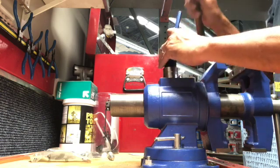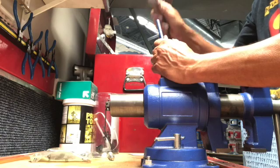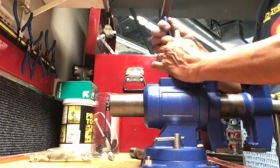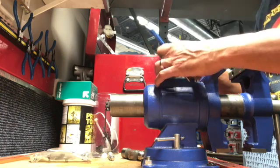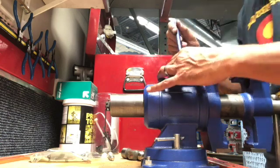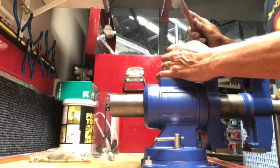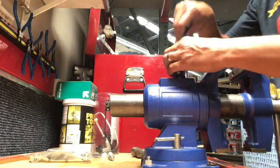The socket gives you something nice and solid to hit on. Sometimes you need to use a really sharp punch with the sharp edge, because there was barely a lip to get any purchase on that outer bearing race — the only part left in the freehub body. Basically just alternate sides, making sure it's coming out evenly. You don't want to push it out crooked or it'll bind up and potentially damage the freehub body or get harder to remove.